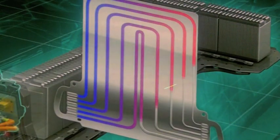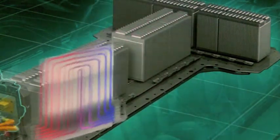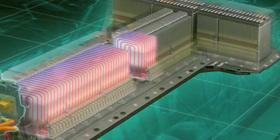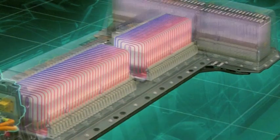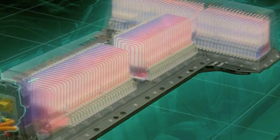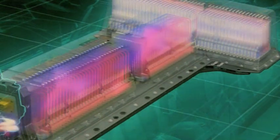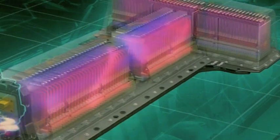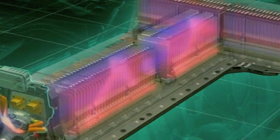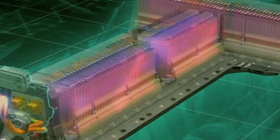The cooling fin uses liquid flow — a glycol water mixture. We both heat and cool. It flows to the face; it's a one millimeter thick fin. There is one fin for every other cell, so every cell is actively cooled on one of its faces, giving us 144 fins. We have complete parallel flow — it's a very high performance cooling system. Two degree Kelvin delta T across any cell maximum, and two degree Kelvin delta T across the entire pack. Very homogeneous — it's really key to long battery life.